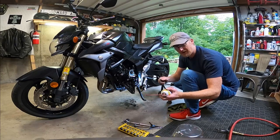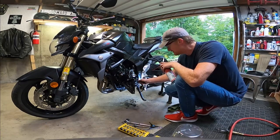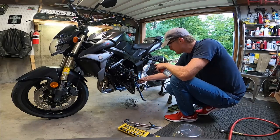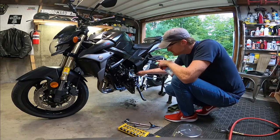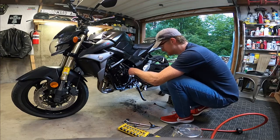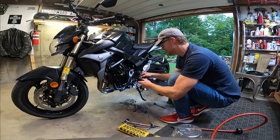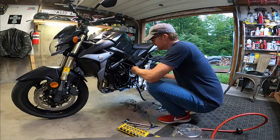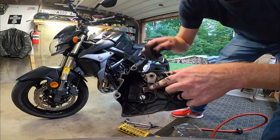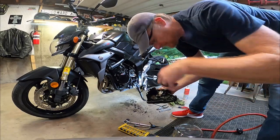I'm trying to be a little sensitive with this stuff because you know how caustic carb cleaner can be. I don't want to douse it. I don't want to run dirty, slippery, grimy stuff into the engine past the seals — so not trying to spray it too hard or too direct on anything like the rubber seals around the clutch rod. I'm taking this off because I want to get it a lot more clean than I can on the bike — I want to put it in the sink and scour it. There's a little tab that's bent over that keeps the cable from coming out. I had to pry that out a little bit and then it came right out. I'll go upstairs and scrub this.